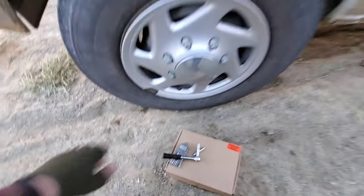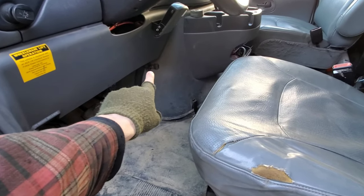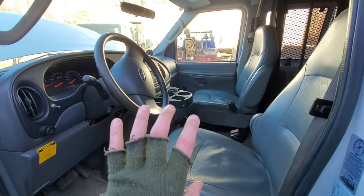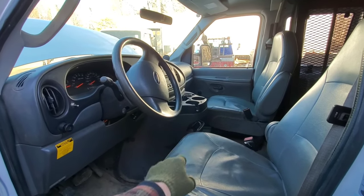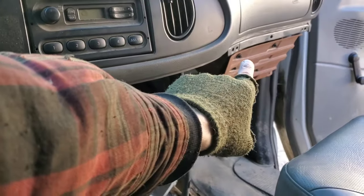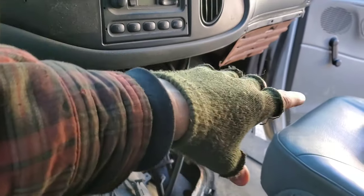When you come inside the vehicle, you've got to pull your doghouse to get to everything. This is what's referred to as a doghouse — there's a latch there and a latch there. The whole assembly lifts out through the passenger side. You can get it through the driver's side, but the steering wheel makes things less fun. With the doghouse out, we found we had to pull that plate off, tilt it at a kittywampus angle, and then out the door.